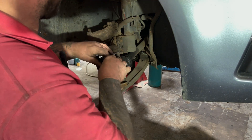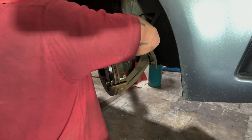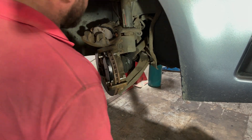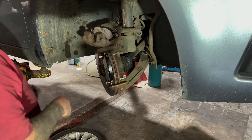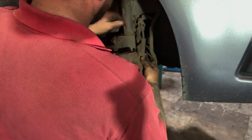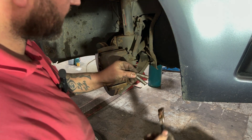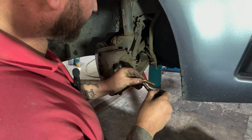The rear brake pad sits in the piston itself on these. That's it all in there. Spin our caliper back over — make sure you've got no twist in your brake pipe. Set that back on. We do put a little bit of grease on the sliders; you don't need loads because it just bogs up and then they stick.